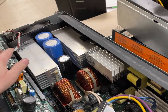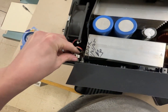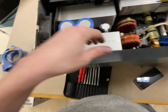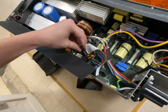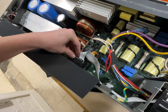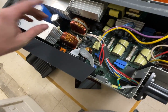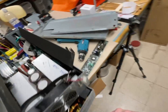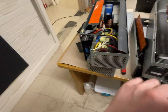Before you put it in, you want to hook up the power switch first, then the fan. The fan does not have any diagnostic pins or pulse width modulation or anything — that's why it can be bad and not make an error message. I'm not going to bother putting these little brackets back in just for the test — that'll be for later.